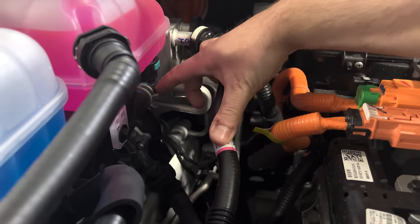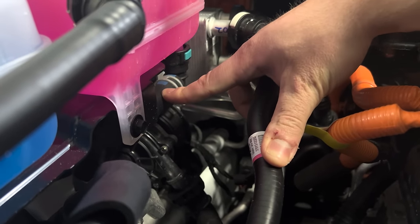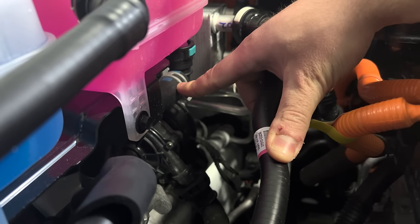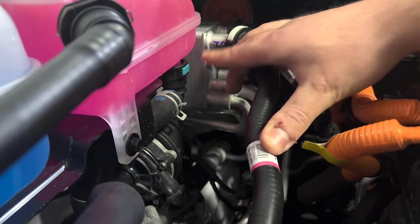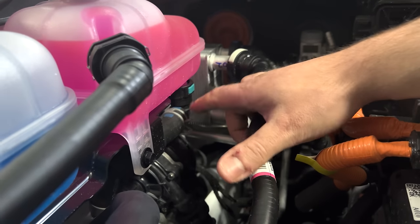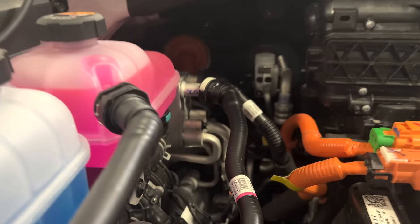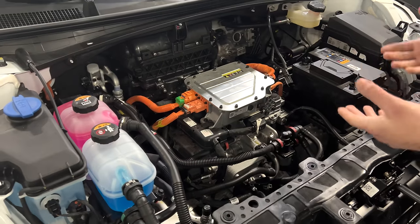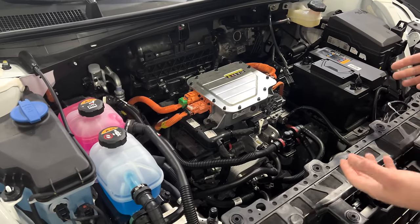And this appears to be a constant tension band clamp around potentially some thermal insulation in the form of a reinforced rubber tube, which is then right next to a quick connect on a nylon fitting that connects to that reservoir. So that on its own is slightly interesting. And then the number of refrigerant lines for the HVAC portion of this system, there are a great many here.